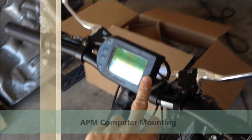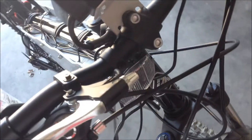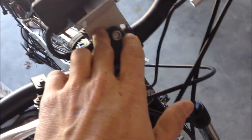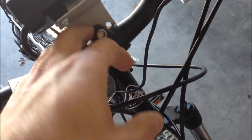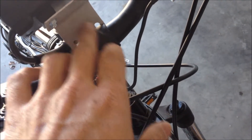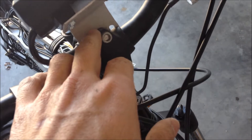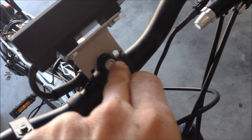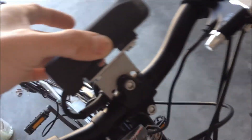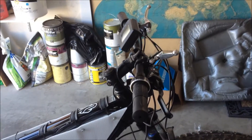To mount the APM display, I removed the top bolt on the handlebar bracket and trimmed the bracket it comes with so that it would fit into the slot and the bolt would go cleanly through it. Just modify the bracket for your specific bicycle to make sure it fits in the slot while allowing the bolt to go through. I also added a couple of nylon washers that I trimmed so the bolt would go through as well. I tightened it back up and it's nice and sturdy. I also bent it a bit after mounting to get the angle to a more comfortable viewing position, and once I'm actually riding I can adjust that angle further.